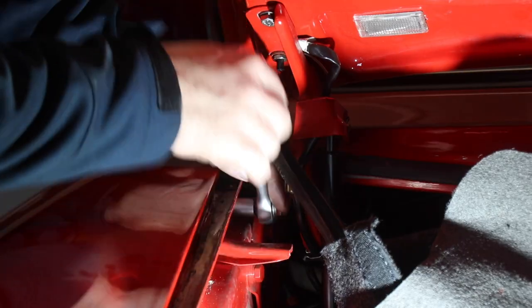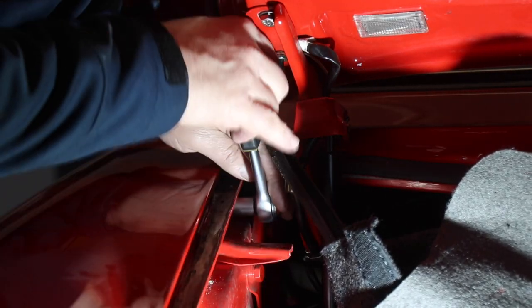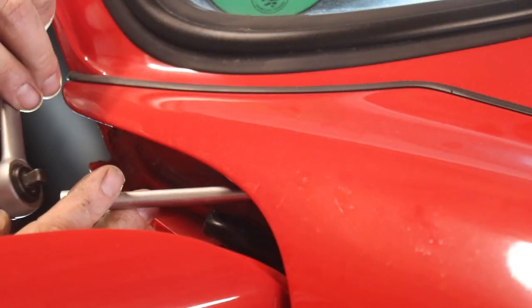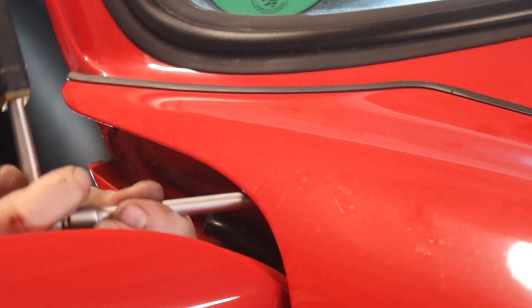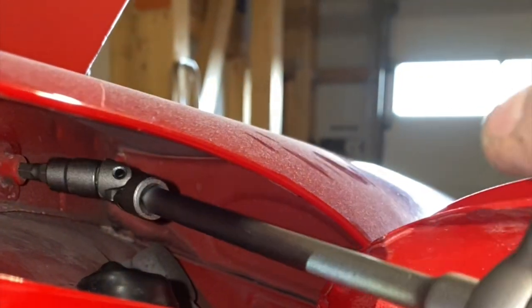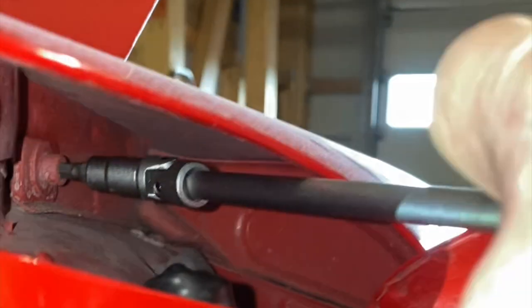In classic 911s, screws are used to connect the fenders to the body, but that doesn't mean they can be removed easily. Some of them, there are 16, can be accessed within the trunk, others need to be taken care of from the wheel well, and they are sealed with stone guard. Two of them, finally, the ones that connect the fender to the A-pillar, need to be removed through the gap offered by the open door, and it's somewhat complicated to reach them. A cardanic joint for the ratchet greatly helps to get this settled.